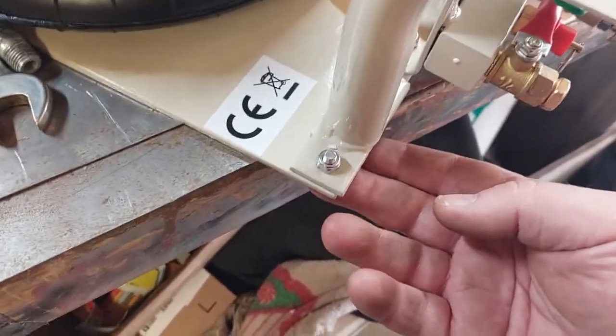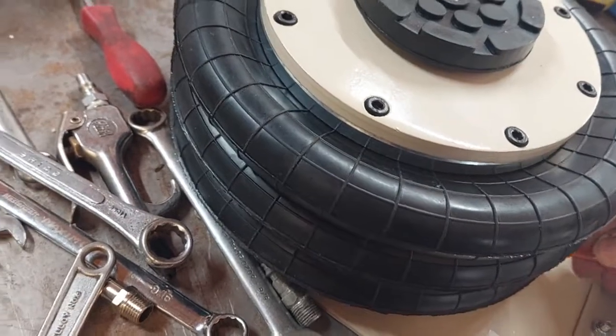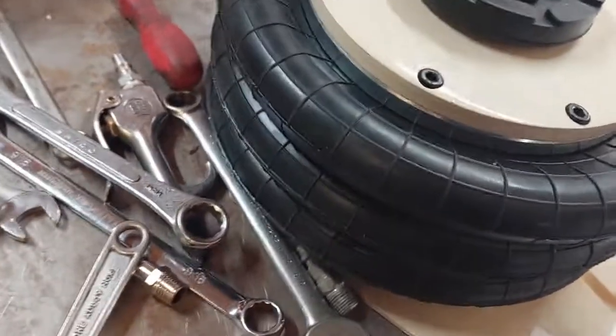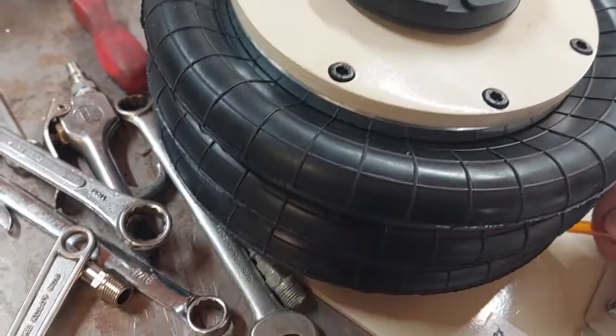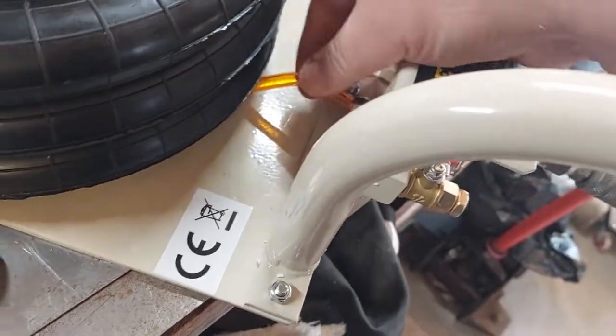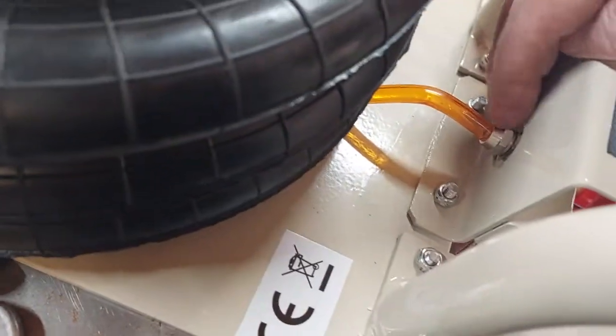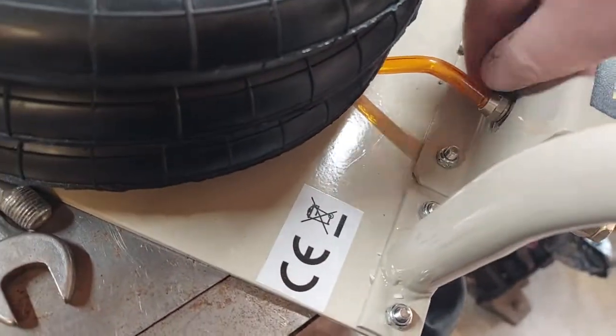There's little cutouts in the bottom, so put them up. And then this hose was too long — there's no way you're going to get that on there. Even if you left it loose and put it on, when you went to push it in to tighten it up, this would kink. So I took off just a little bit each time. I still got a bit in there, but I didn't want to go too short — if I went too short, then you're screwed. Make sure you slide this coupler down on there before you cut anything.